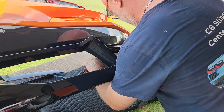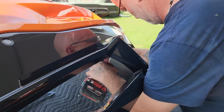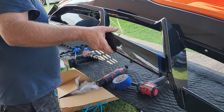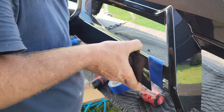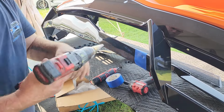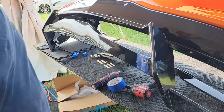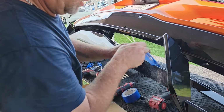Open the holes up a little bit more, to allow for a 1/4 inch bolt. So all 4 of those get drilled out, both sides. Clint's fitting it so he can mark exactly where the attachment point is going to go, so that he can drill that in. So he's going to drill a hole here to do the other side as well. And that's where the new piece will attach, and then they're going to cut off the middle segment.